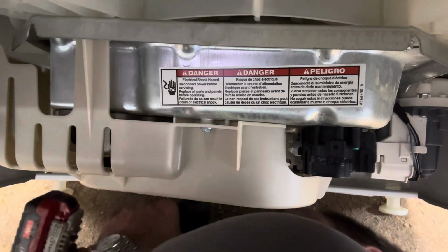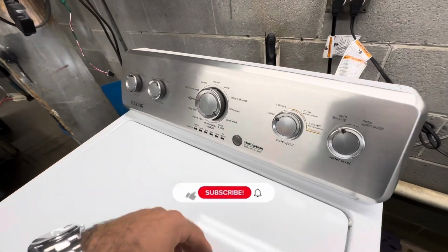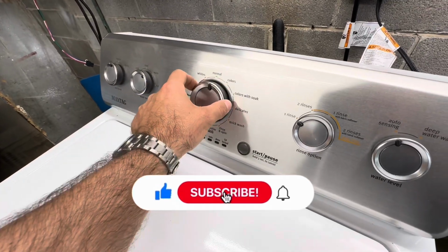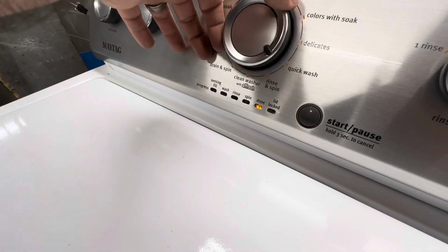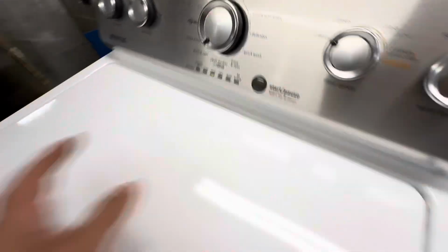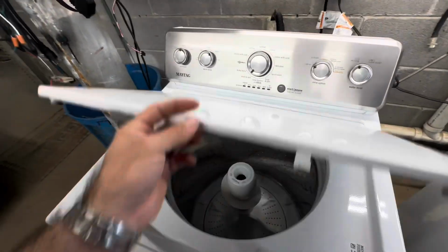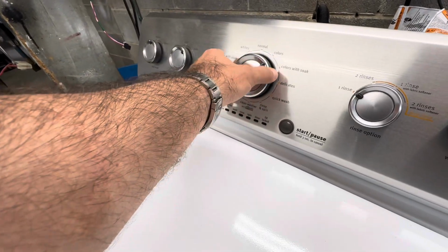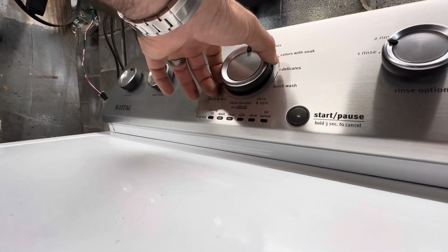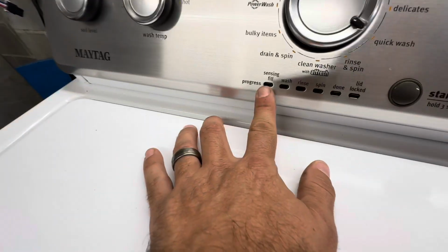No, surprisingly. Check it out. All right, just for the heck of it, let's do a recalibrate. Left, right, right, right, left, right, left, right, right, right, left, right. That is recalibrate. You can't have anything in there. Now to do its stupid stuff. And it's done. Pow. Left, right, right, right, left, right, left, right, right, right, left, right. No codes.